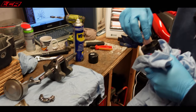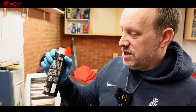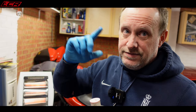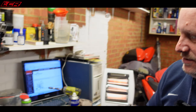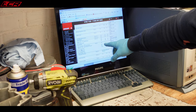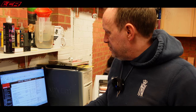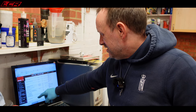So this is build oil. There's a bit of division in builders as to using this stuff - some people like putting a really thick grade mineral oil in the build, which does the same as this. This is just a really thick lubricant that's washable with your standard engine oil. What it does is it means those first few cranks where you might not have oil pressure because the engine's totally dry - it will protect everything. More importantly with your big end bearings, you definitely want them not to touch at your first start. So we're going to have to tighten to 35 newton meters, then back off by 360 degrees - a full revolution off after two seconds. Then we're going to do 20 newton meters, 35 newton meters, and then a 30 degree final tighten, and it shouldn't really be any more than 70.5 once it's been tightened up.